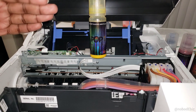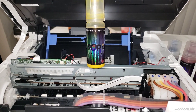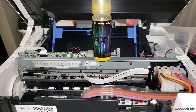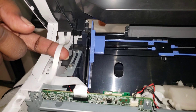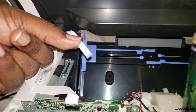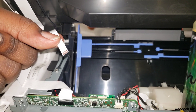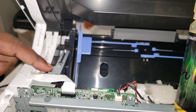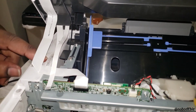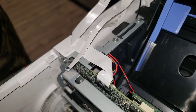As for the scanner error: I had my printer lid lifted up and the back cord came out. I get a lot of comments like 'I'm getting a scanner error code' — I got the same code. I didn't do anything special. I basically evaluated my printer and learned that this little white connector had slid out. So after examining it, I'm like, man, what could it be? And I found out this came out.